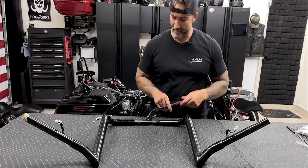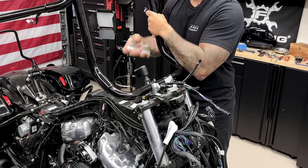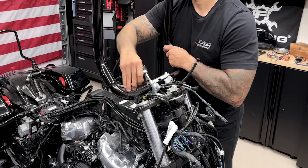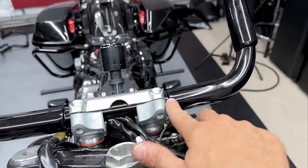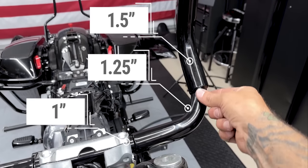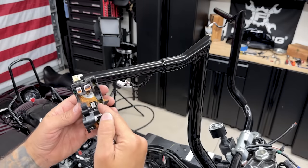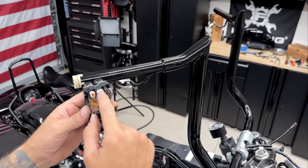We're wired up — we'll clean this up. Now I'll get the bars back on to mount the left and right-hand control modules and switch housings. After that, we'll get the lines routed for the brake line and clutch line extension. When mounting the bar, make sure you have equal space on both sides when mounting the clamp. What's great about these bars is they go from inch-and-a-half to an inch, so you don't have to modify your fairing. Here's the right-hand control module — get the connectors connected, run them through the channel through the fingers, then connect them for the run/stop switch and right handlebar switch harness. Make sure they're fully seated.